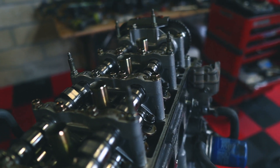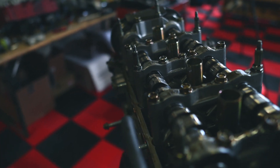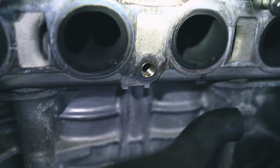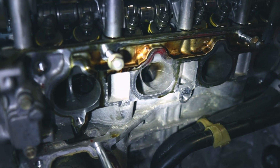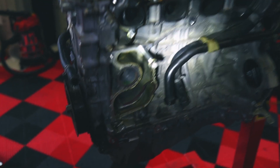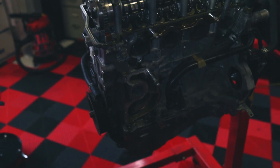I can also see that the engine is in better general condition than my 2ZZ that I put in, because the 2ZZ was so brown inside due to old oil and probably a lot of blow-by and fumes that made everything very dirty inside. You can tell that this engine is way cleaner — it has like 150,000 miles. However, there is a lot of soot inside the exhaust ports of the cylinder head, and that is going to need a lot of cleaning. On the intake side it's also not super clean. So let's give all of that a clean — make sure nothing falls into the cylinders. That's something you definitely have to watch out for. You can also tell that the cooling wasn't changed all too often, so we're definitely going to have to give it a clean and flush out the residues.